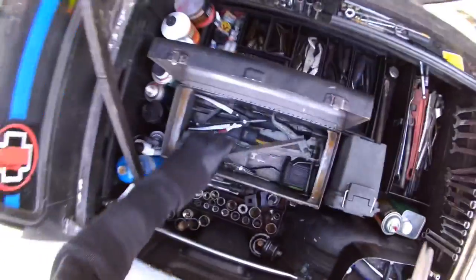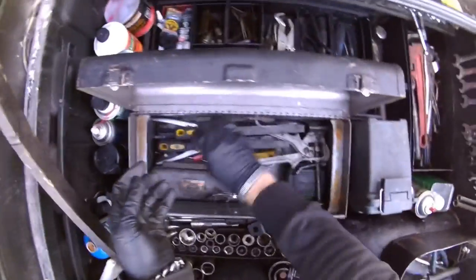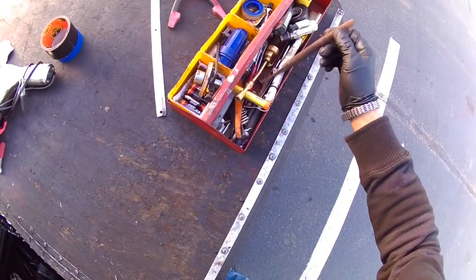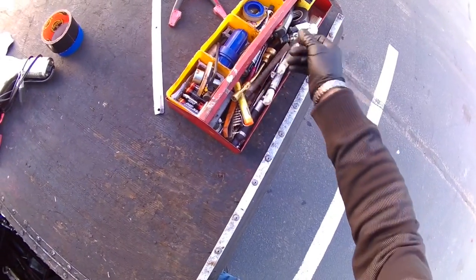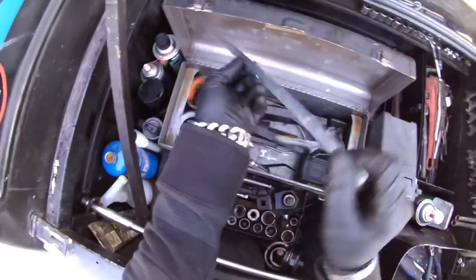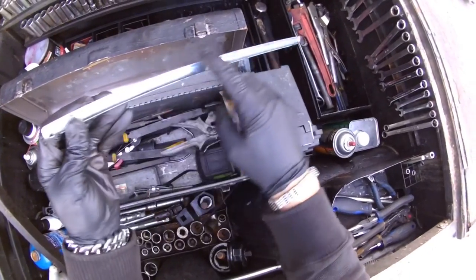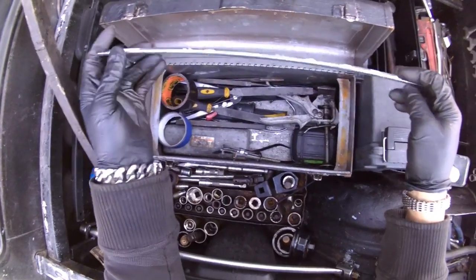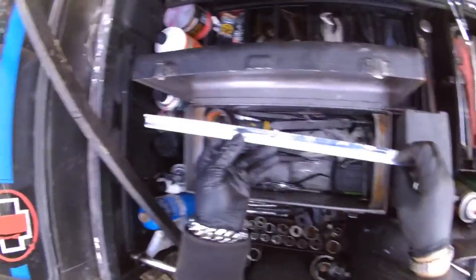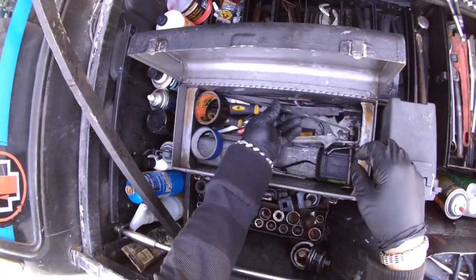Files — make sure you have yourself a nice set of sharp files. It looks rusty, but it works really well. Sharpening stone from a knife. I have a lot of small files in here too. When they start getting dull, just throw them away and move on. Sometimes you gotta replace some tools. This is what I use for a straight edge — it is not a straight edge, but it is straight. I believe I tested it on some flat surfaces at less than a thousandths of an inch, and most of the time you have two thousandths of an inch. The head gaskets that I have done with this have been going for over a year now. I keep in contact with the owners and they have no issues, so I'm not worried about it.